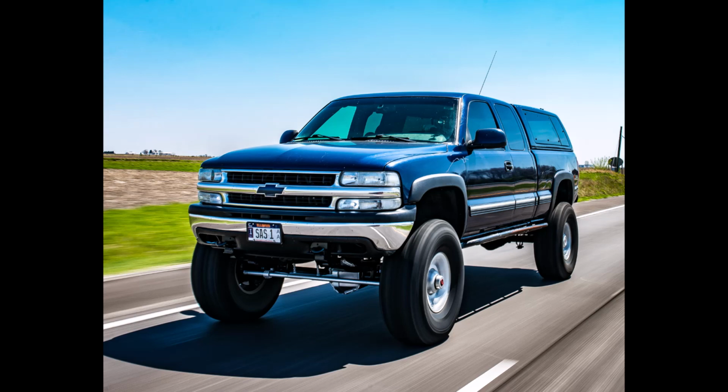Nope. And actually, one more thing that we have on here that we didn't put is that I kept the engine and transmission tuning stock, because GM put millions of dollars of R&D into the LS and the 4L80, and they work. Yeah. And I don't want to put a cam in it, open it up, and possibly screw it up. And then when I'm in Moab next time or wherever the heck I'm at, the cam bearing is chewed up. Mm-hmm. You've got reliable horsepower that works. It's enough. You don't need more.